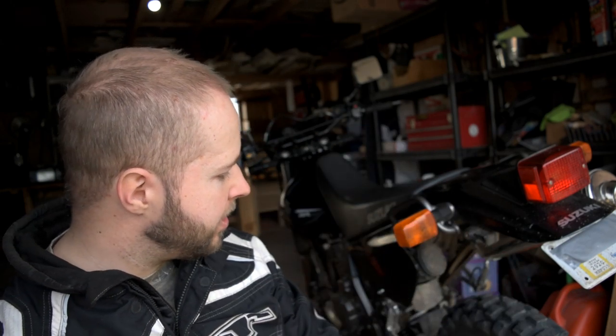Now I've got pretty much everything I want in a bike. There are a couple more things probably going to be winter projects - I'm going to put a D606 on the front as well, and we're going to be looking at changing the bar setup from those crappy stock bars. Thanks for watching - hit that like button and subscribe to my channel if you haven't already. If there's anything else you want to see, suspension mods is something we're looking at. Someone noted in the GoPro footage in one of the last videos that the bike is diving on the front end - that's a known issue with these DRs. The stock springs are so soft and spongy and the front end just dives all the time. So I might get some stiffer aftermarket front fork springs and a stiffer rear dampener.